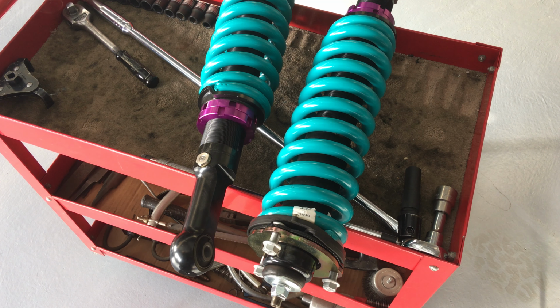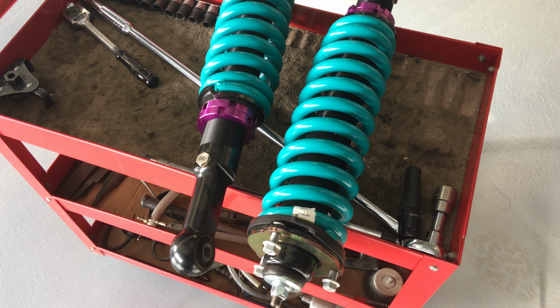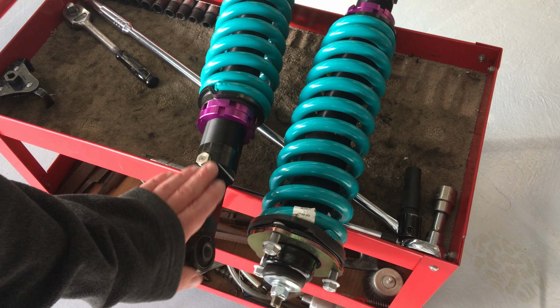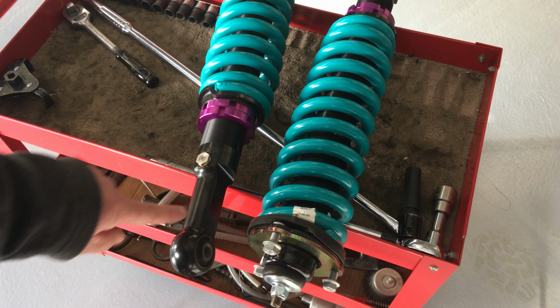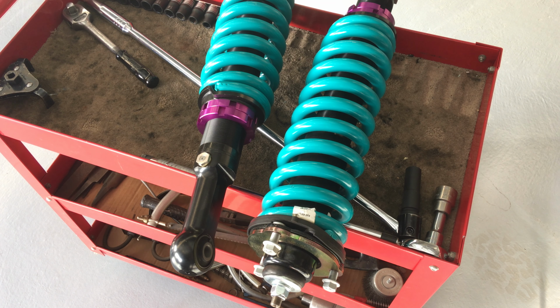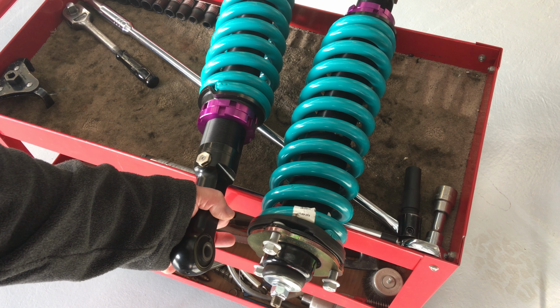See all this, the video is about strut spacers, but see how we're just throwing in all this other info. It could be a separate video and we will, but it's important to talk about these bushes. The point I'm trying to make is though, the standard suspension, this upright section here, I'm going off memory here, last time I measured one, it looks like 14 mil diameter, but it's probably about 15, maybe 16. And most upgraded suspension manufacturers will go to 18 or 19. I know it doesn't sound like much, but it's getting quite much bigger here.